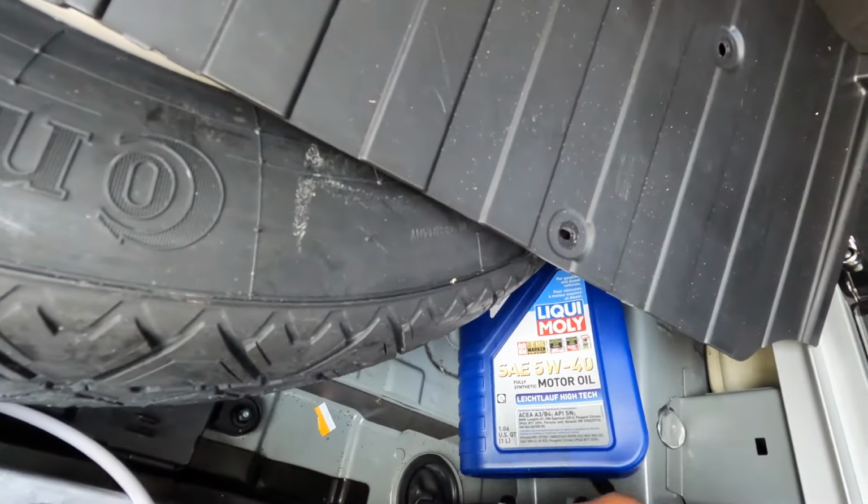If you're wondering, the smaller battery, I believe, does not have to be coded. There isn't any way to code it, because I think you just code the main larger one to a 90. There is no way to separately code it. So you just pretty much plug and play, swap it out. If you can find it, they are hard to find. As of right now, I was able to find it on Rock Auto. And I'll provide the link in the description. I don't know if it's gonna be valid by the time you see the video. I don't know if they're gonna sell out or links change, but I'll provide the current links.